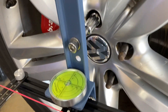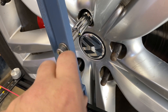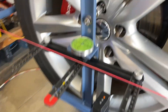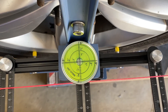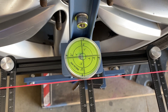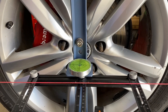I've put little yellow caps at the end just to protect the rim surface from scratches. I drilled and tapped a nut at the back for a cap screw that goes through and does the mounting. I've welded it up, and there's my bullseye level. If I adjust the tire you can see it doesn't take much — just adjust it ever so slightly and the bubble comes back. That tells me when it's absolutely straight up and down, and that's my first measurement.